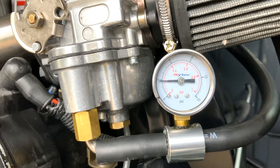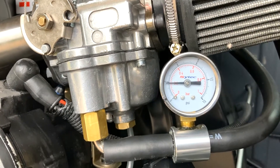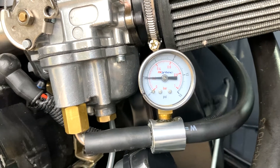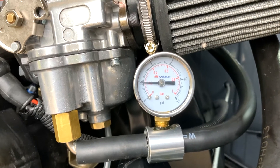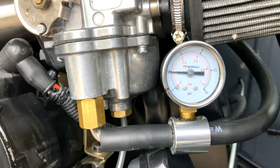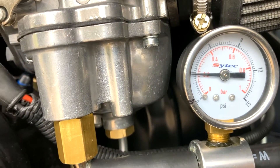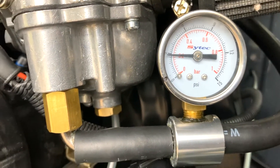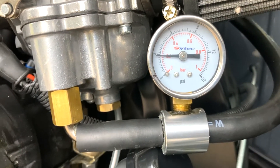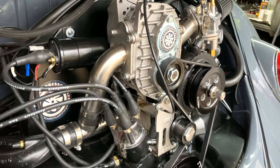Go to your ignition and turn it on. When you have fuel running through the system and it's primed up, you should hear the fuel pump stop - that's assuming you've got one of our fuel pumps. They are self-regulated and will stop pumping at 3 psi, which helps this setup enormously. Turn your ignition on and you should see it set to around 3 psi or 0.2 bar. At that point you should be able to start your engine, assuming you've got your timing set up correctly.